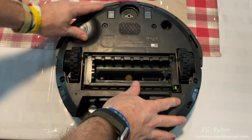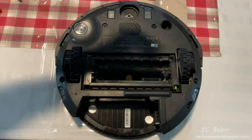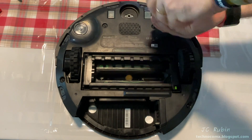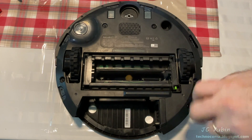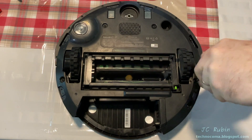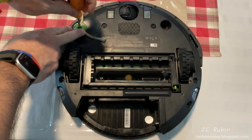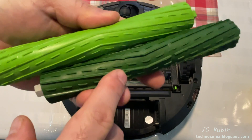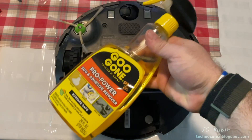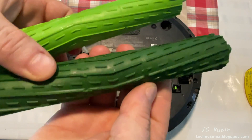Now dried, I lay the cover right over into position making sure none of those three screws fall out — it seats perfectly into place. I screw in the screws starting with the one on the left, then the one on the right forward of the sensor, followed by the two removable screws up front near the swiveling wheel, and finally the screw rear of the sensor. Once seated I go around and very gently snug each screw — not too hard, remember we're snugging into plastic. These are the same rollers you saw at the beginning — I wrapped them in a paper towel, sprayed with Goo Gone, let them sit for about 10 minutes, then scrubbed with an old toothbrush.